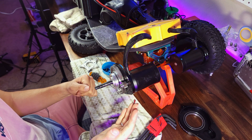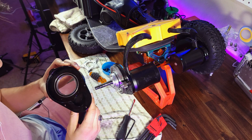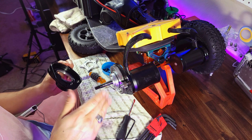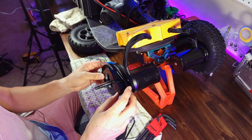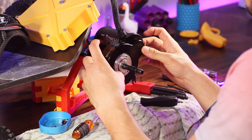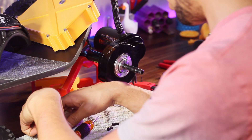Now that your gear set is done and your drive gear is back on, the next step is putting the case on the actual drive. Now is a great time to apply some grease — mine already has grease applied and it's just worked its way around. You don't need too much, just enough to keep the gears working well. Apply your grease, then put the casing on. It should fit pretty much all the way down with a tiny bit of a gap where it'll slide — that's the bearing sitting on the o-ring. Now take your four M4x10 screws.